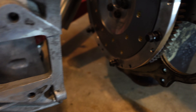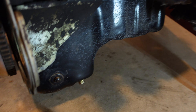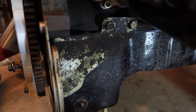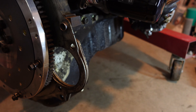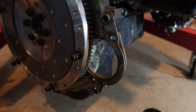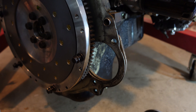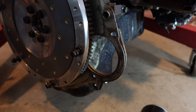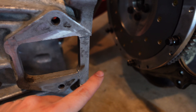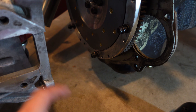When I bolted this up, you can see the starter mounts through this little hole right here. There's actually a gusset plate — the kind of mud-covered gold thing back there — and that's where it mounts to from the engine side. Typically on a Z31 engine or transmission it would have a very similar bolt pattern on the other side to brace it from the transmission. When I put this up against here, this bar right there was right across the face, so obviously that needs to go.